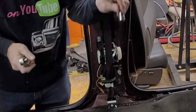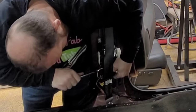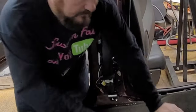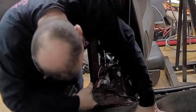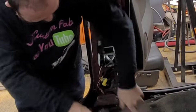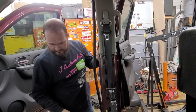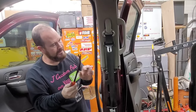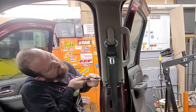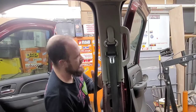At this point I've got my T-50. I'm just going to stick it in right here, break that loose a little bit, then use my impact — it's just easier. The bolt just drops out just like that. Then I take my tool and I can see the back side where the clips go — same clips — and just pop those loose. I can get it from the other side here too.